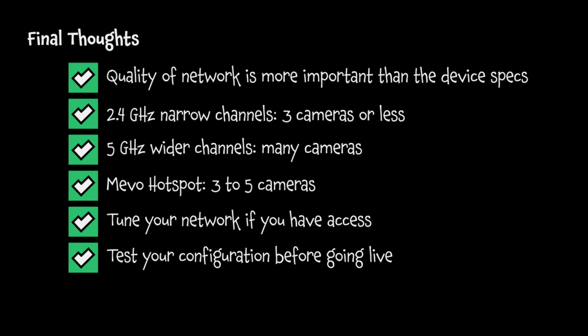If you're using a Mevo Hotspot and using cellular data for your uplink, then you can expect to get 3 to 5 cameras on a 5 gigahertz network. And if you have administrative access to your Wi-Fi network, then definitely tune it by scanning and choosing Wi-Fi channels that are not congested. And of course, test your configuration before going live.